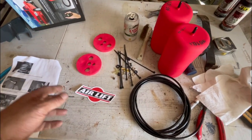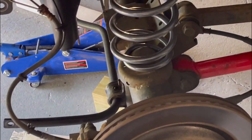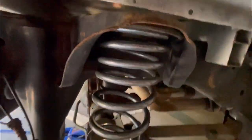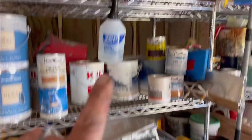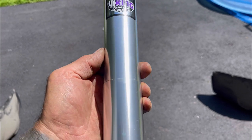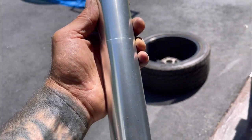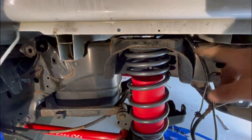Before I forget - I've got to put my airbags in because I tow and I want to make sure I don't have issues. My trailer is kind of heavy, it's an old steel frame double axle. This is for a Durango - they tell you to poke a hole in the bottom rubber diaphragm on the bottom of the spring seat, but mine is metal so I'm pointing mine up because there's a hole in the top of the tower for the line to run through. I'm just going to stick them in the spring and run the lines up and then run a nipple off to fill it up.